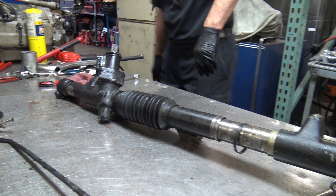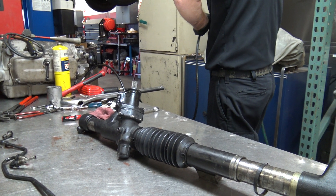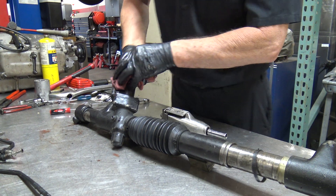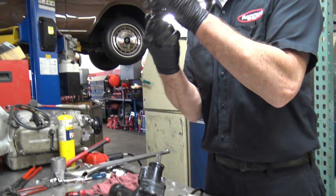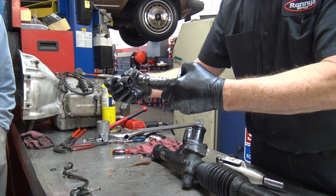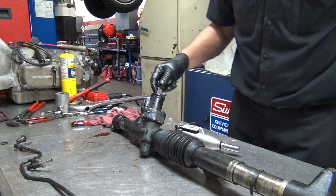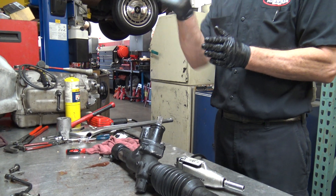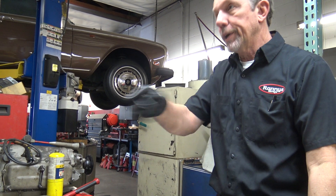Let's pull off the top of this — the spool valve on this one — and you'll see a big difference. It's oriented the same way. The only thing that's really important on these, especially when you get to the airbag cars, is if you look at this tower, it's got a slot that goes all the way around. There's a clamp — this is a part of an old steering shaft — it fits on there and slides down, and a bolt goes through this gap to tighten it. Now if you look at this spool, it's got a flat on one side. So when you take it apart, you've got to put it back in so it faces the same direction. Otherwise your steering wheel is going to be off, and with an airbag car you can't just pull it off and center it — you'll end up having to buy an airbag reel. So this is very critical.